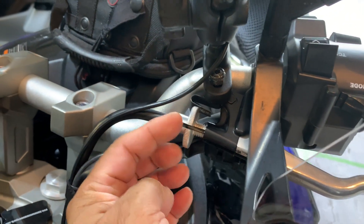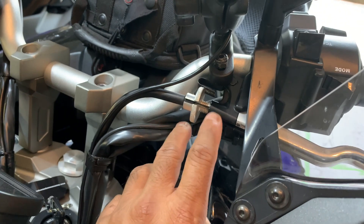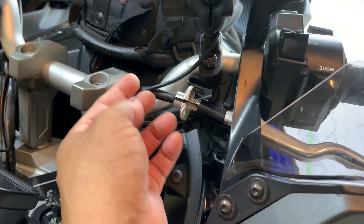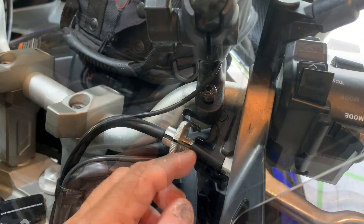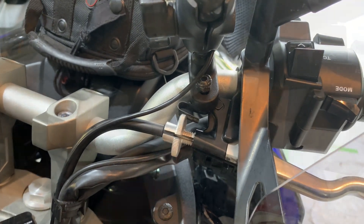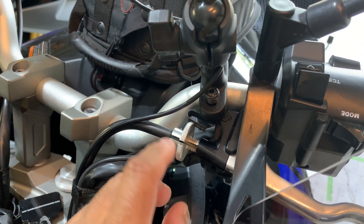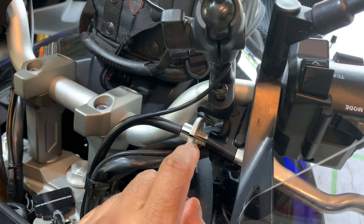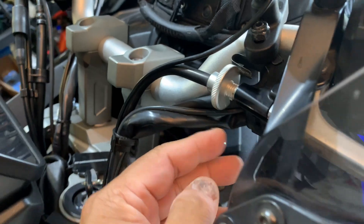I've got to keep turning this back to push this in, then line this slot up with this slot here, remove this cable from this assembly, and inject my lube. I can do all of that on the bike. Another tip is to not have this slot facing up because then rain can get down in there easier and rust it out. You want it facing downwards.